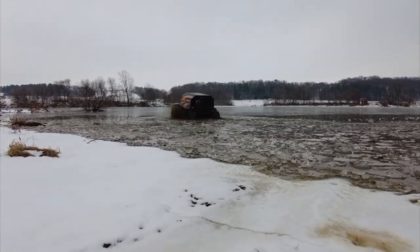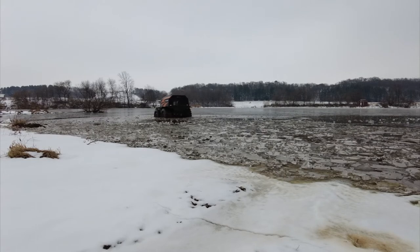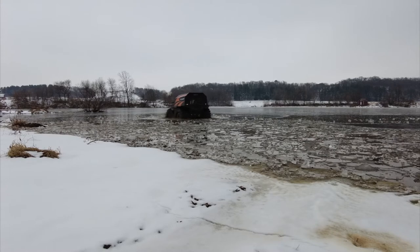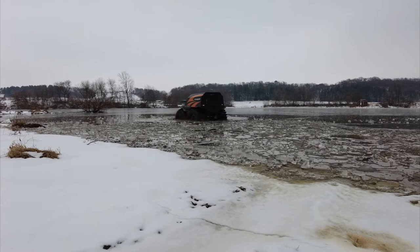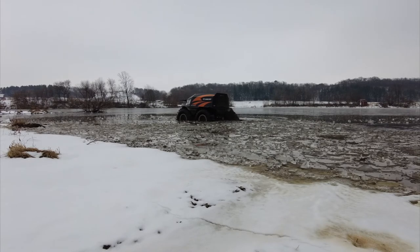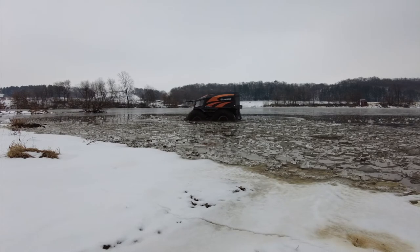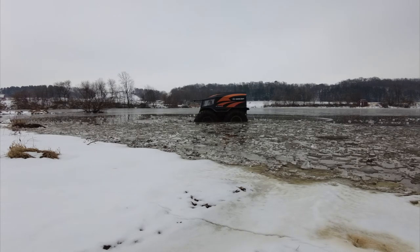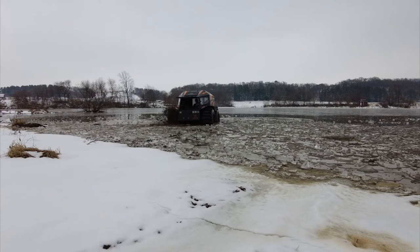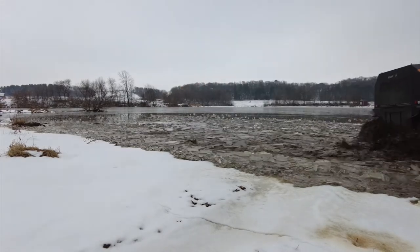When you do try to go up on top of the ice and it's thick enough — which this is not — you'll notice the front end will pop up in the air once in a while. You can go up backwards on top of the ice too. When you're popping up, the front tires get on top first and then the back ones try to grip and catch up. You want about 60 millimeters of mercury of air pressure inside the tires — that's less than probably one PSI — and you're in second gear basically punching it. If you go slow it doesn't do anything, it just kind of paws at it. Second gear, 60 millimeters of mercury, patience — you'll get back on the ice if it's thick enough.